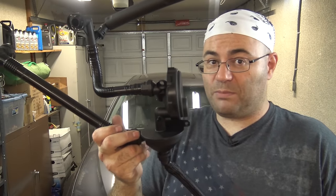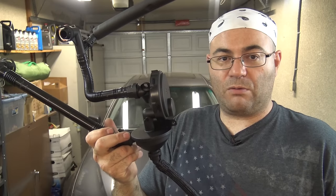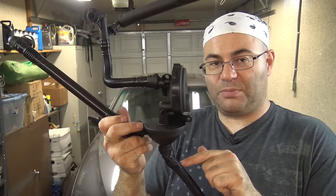If you haven't replaced yours, or if you're having problems — if you have a P0171 and P0174 and your car is running rough, especially when you first start it up — this is your culprit right here. You have to replace this tube.